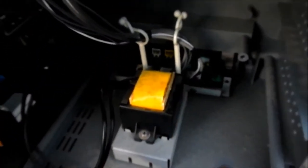Over here is the power supply board with lots of cool parts — some good capacitors. This one is a 10 volt 15,000 microfarad, so practically a supercap, and there are a couple of other big ones tucked in there. This transformer here only seems to have two wires into it, and under the tape it does appear to be center-tapped on the other side with some extra windings, but I think it's just being used as a choke — possibly to limit the mains current going to the high voltage or something else.